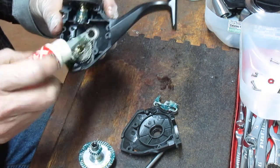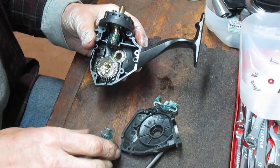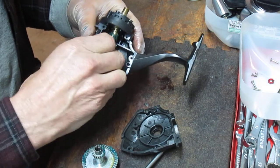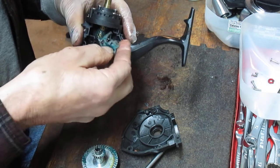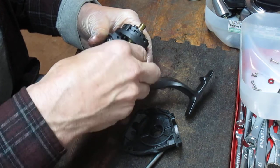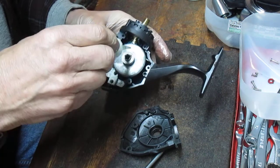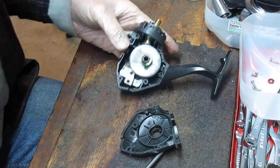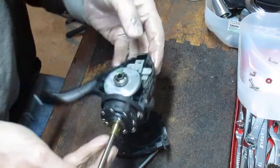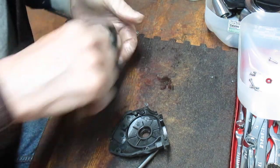I've put the back bearing in. I use oil on bearings and blue grease on the moving parts like pinion gears. Now we're going to reinsert the crosswind block — just have to line it up with the stud to make sure it's on there — and go ahead and put the main gear back in. Make sure that's properly seated. Then I put oil on the front bearing and reinstall the shaft, which was held in by two screws. Just have to work a little to square it up — and there we go.